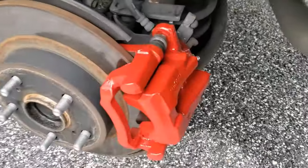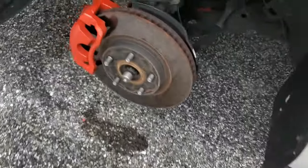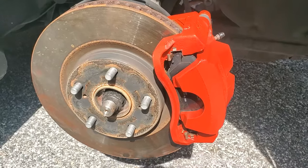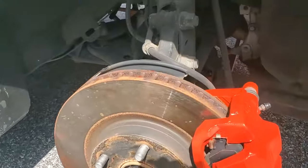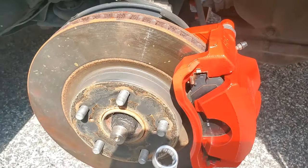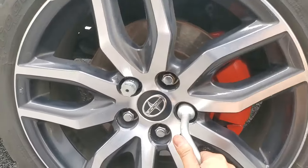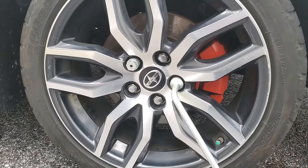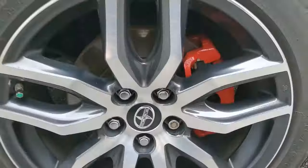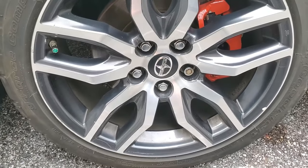They say you can let it dry two hours before putting the wheels back on, but that's under the assumption you're not removing the calipers like I did. I wish I had remembered to put cardboard underneath everything — it's going to be a real pain to clean up the driveway later. Now torque the bolts to spec: set your torque wrench to 25 foot-pounds and tighten down all eight bolts. If you have a problem with the guide pin spinning, use a 17-millimeter box wrench. Put the wheels back on and tighten the lug nuts in a star pattern, then lower the front wheels to the ground and torque to 76 foot-pounds in a star pattern. For the rear wheels, set the e-brake and tighten those in the air.